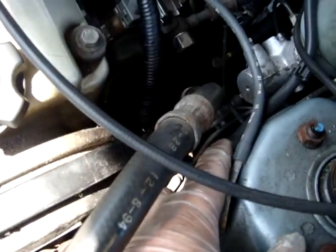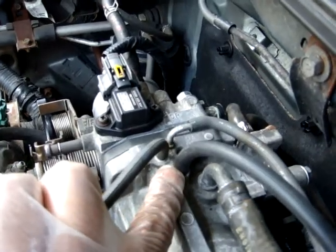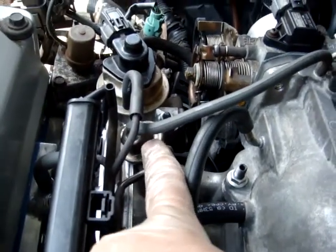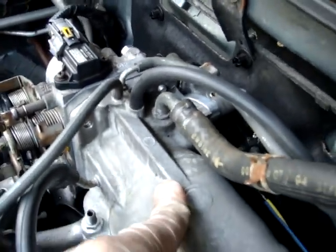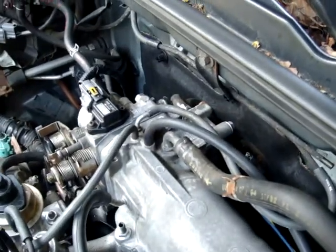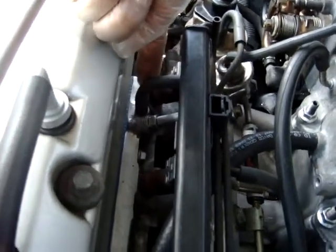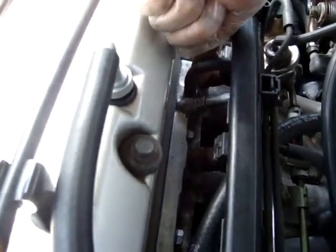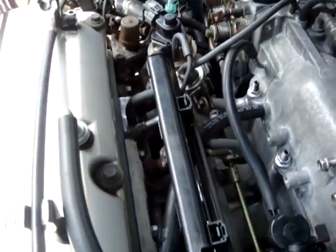The bottom of the vacuum hose runs all the way to the top — you could use either one, but that connects to the one over here. Fuel pressure regulator is up here too. If you have cruise control, which I'm keeping, I ran that vacuum hose straight through there just to test it out right now. Also, you have the nipple for the FIA — run that over here straight to the bottom of the FIA. The top nipple of the FIA goes into this nipple here.